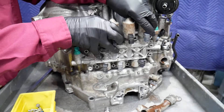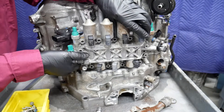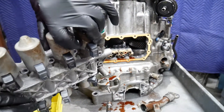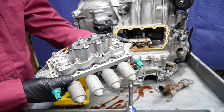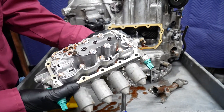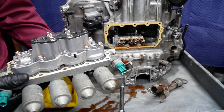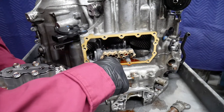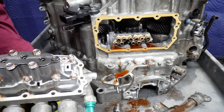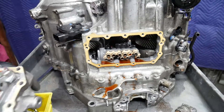Now we're going to carefully remove the solenoid pack — you're probably going to have to just very gently pry to pull it loose. Here we see the solenoid pack, part of the valve body, and here we see our individual distributor tubes. You'll notice that all but one have the cup-style filters, which of course will be inspected and cleaned.